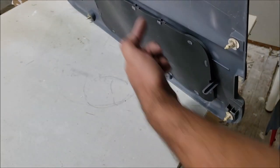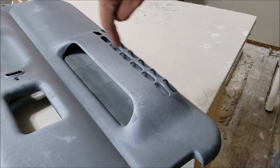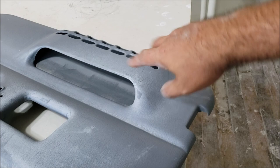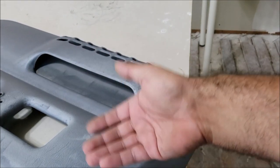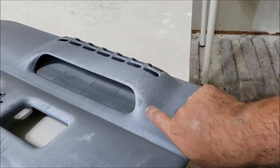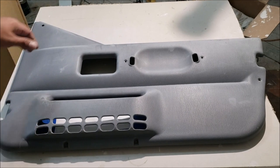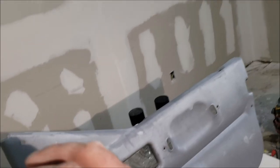The only problem with this panel is it's got this little bucket area — it's another piece of plastic. The problem with spraying inside there is we could get a weird spray pattern or little dots sprayed in the bottom. So I'm going to mask that piece off — it's a way better idea than trying to spray in there. If you could take that piece off, that would be the best option. It's nearly impossible to get good coverage inside that area, so let's just mask it off. You want to be able to walk around the panel and prop it up.